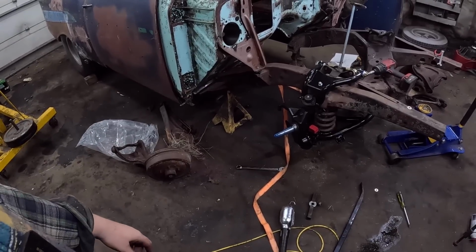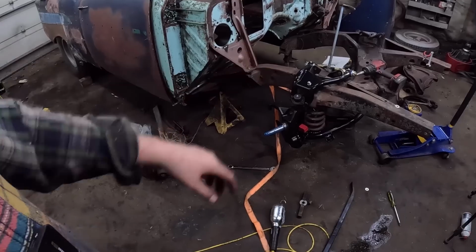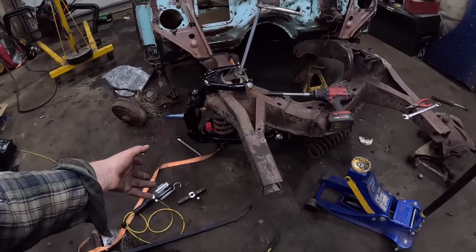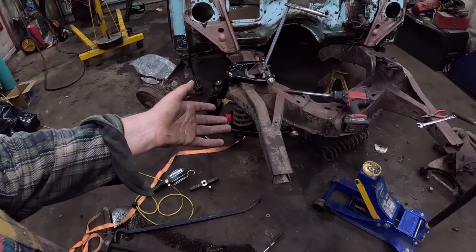But I'm not doing that tonight because I'm tired. I locked everything together like an idiot. So I will take the spring out and take all the hardware out. It actually was okay, but while I'm up tomorrow, maybe I'll get some new hardware that I know is proper American, grade 8, just because it is the front suspension. And we'll go from there.